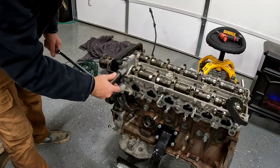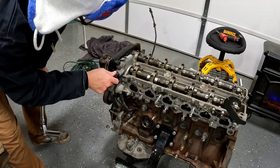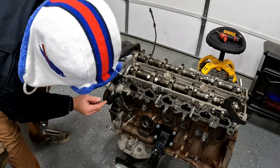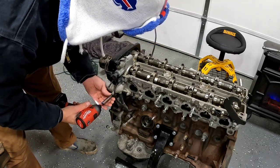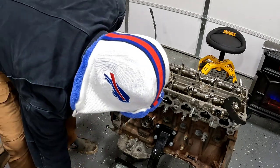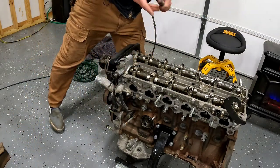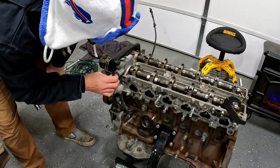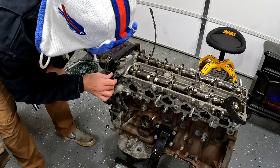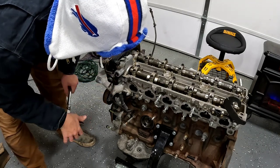I'm just going to start taking stuff off that I know has got to come off. We're going to take the variable valve timing solenoid's oil feed line off. There's a filter inside here when you pull this bolt off that obviously has to go back in the motor. If you are not someone that does this often — and even if you are, it's not like I'm the world's 2J expert, it's the first time I'm building one — put bolts back where you get them from. Then there's no guesswork when the time comes to reassemble. Maybe a part you need is back-ordered and you think the motor is going to come apart and go back together quickly, and it doesn't.